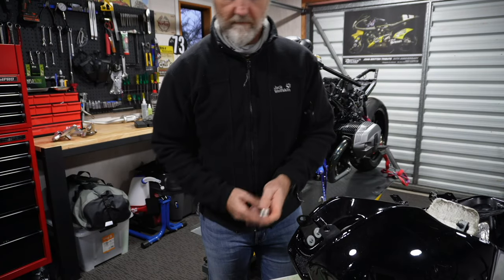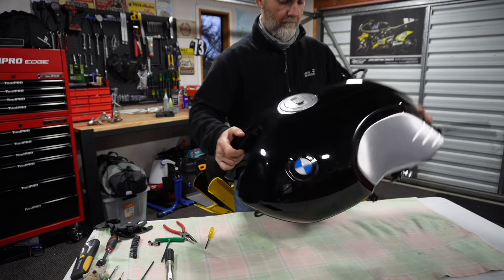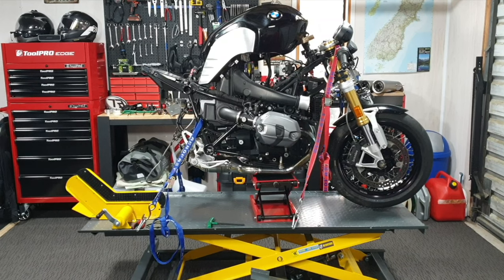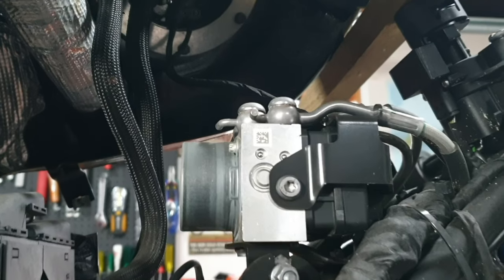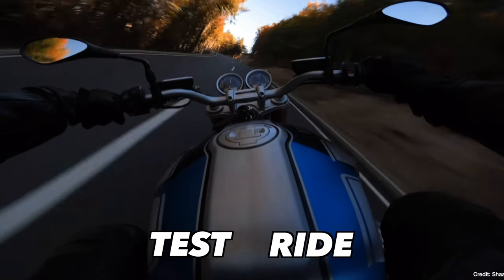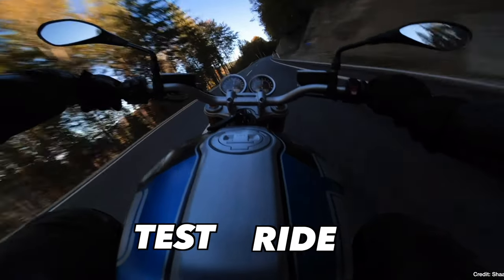Put enough fuel in the bike to test for any leaks. Leave for 12 hours, then check if any fuel has escaped. If not, reinstall your tank but leave it unmounted. Turn on your bike so it can pressurise the tank and check if there is any fuel escaping. Then bolt down your tank and, for extra safety, check a few times during the next couple of short rides around your neighbourhood that there is no fuel leakage.